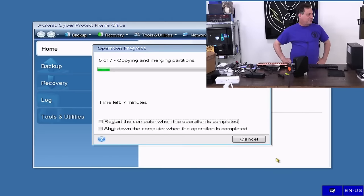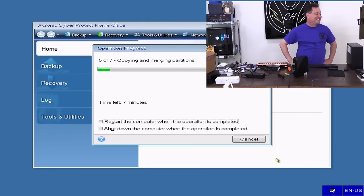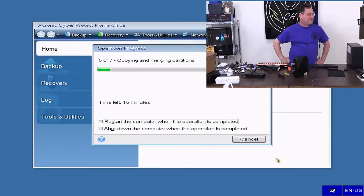David Dix at Rock City PC said, yeah, Dell is notorious for setting the controller in RAID mode. They did that when Optane was big too. He said, I've got like 10 or 20 16 gig Optane M.2 drives that I use for super fast Windows installers. That's cool. Doman 2000 said you can also clone or image directly from Windows itself. Hot imaging VSS, if the image tool supports it, it works pretty convenient.